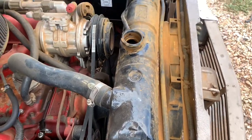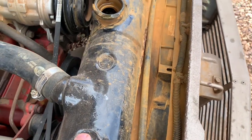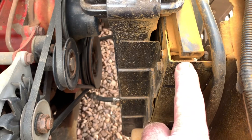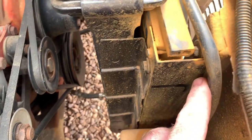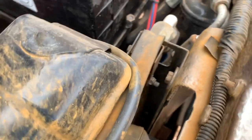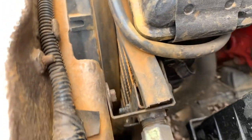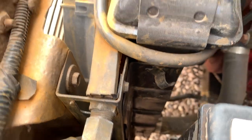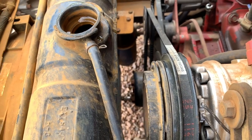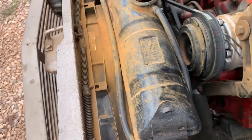If you're interested, I got the air conditioner condenser fitted in front of the radiator by putting a 50 mil spacer with a channel, so that originally bolted to the original bolts on the radiator support panel. Then I put the condenser inside of that, and then obviously the radiator bolts to that. It brings the radiator closer to the engine by 50 mil, but because I'm not running a fan, it doesn't really matter. And that way I've got a big thermo squeezed in the front there.